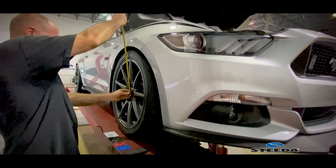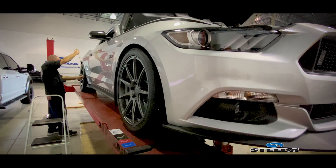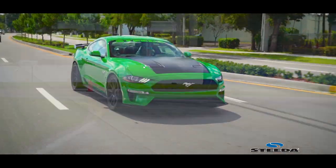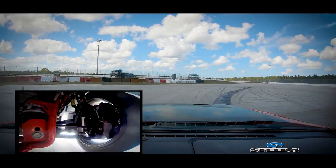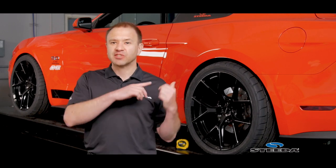We took the measurement while the car is sitting still — at its static stance or ride height. This is important because you cannot measure the dynamic ride height, which is when you're driving the car down the road. No road or terrain is perfectly level, so you're going to have suspension movements — whether compression or jounce — and rebound when it comes back down. In order for the suspension to do this, it needs enough room to travel upward and back downward. You've heard the term bump stop or jounce bumper — these are items to keep the car from bottoming out one suspension component against another, from bottoming out the internals of your struts and shocks, to keeping the axle and tire from rubbing the tops of the fenders or the sheet metal. Ride height is extremely important from both a static and a dynamic standpoint.